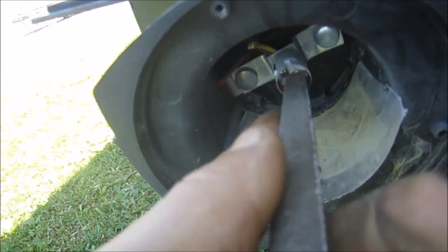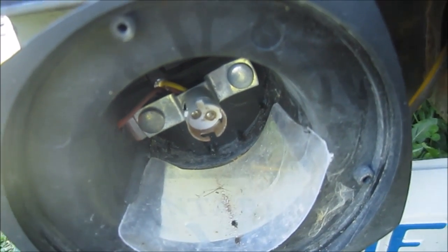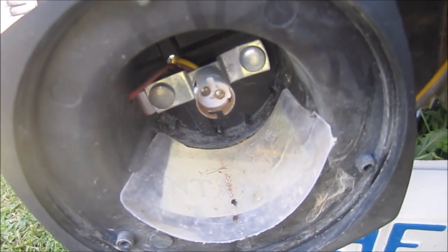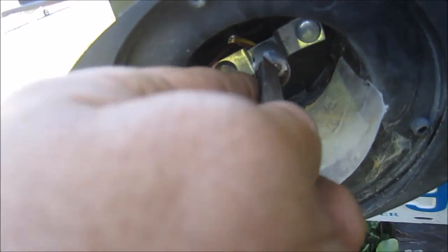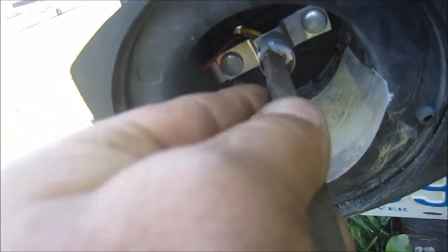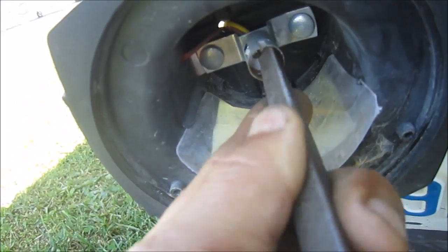And once you have, and you know all that's good, and something's still not working, or everything's not working, then it's a wire issue. Which I don't think it is with this trailer, because the wire itself is inside the tubing, so it's highly unlikely that the wire is damaged. I could understand if the wire was just strapped underneath the trailer, because then it's exposed to the weather and may have got some cracks, and the wire itself could be corroded. That may still have happened, but I'm going to go through these steps first to make sure.